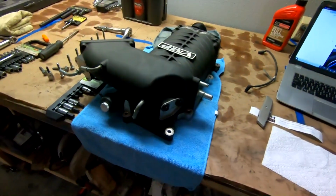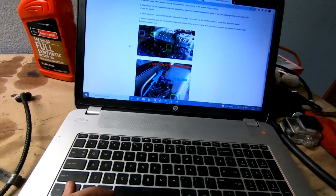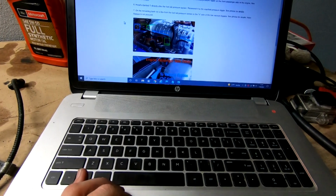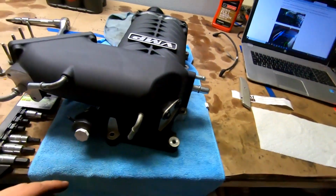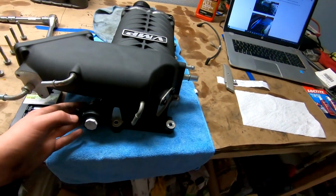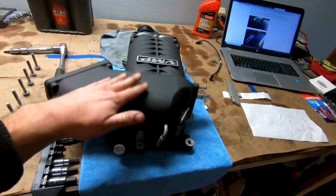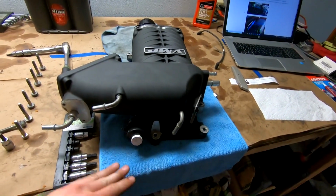All right, so this is very interesting. I'm reading up on exactly how this install goes. I realize you guys can't see this, so I'll link the L&M install instructions down in the description below. Basically, as you saw when I was putting it together, the bypass is now open instead of closed. So the cams will suck significantly less vacuum than the factory ones will.